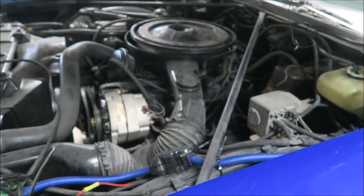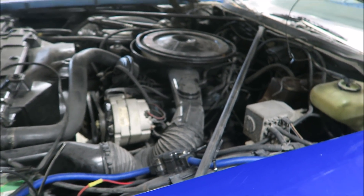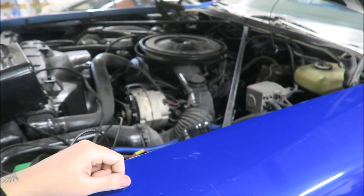The plan for this thing — definitely not mine — is they want an LS swapped into it, a decent cam, something they can street drive. They're not trying to make a thousand horsepower. Holley High Ram, Terminator X, Turbo 400. Right now it has the old Rocket 350 in it and a Turbo 350. They want to LS swap it because they couldn't get it running.